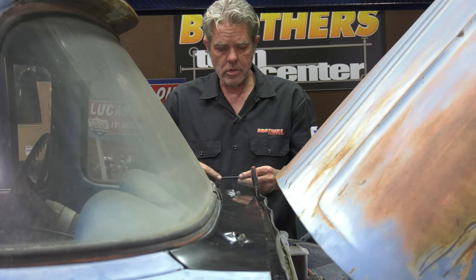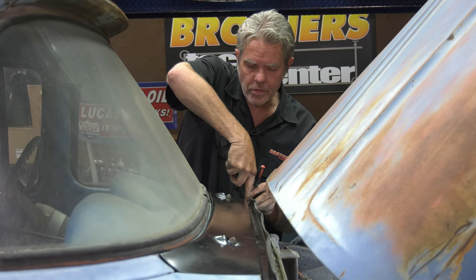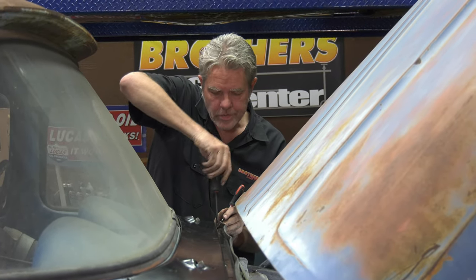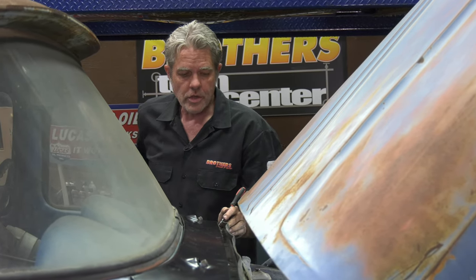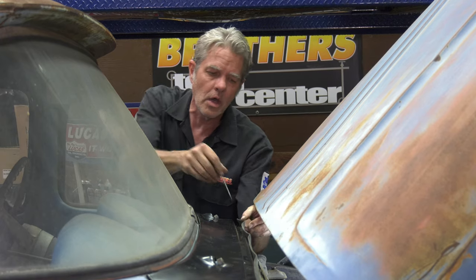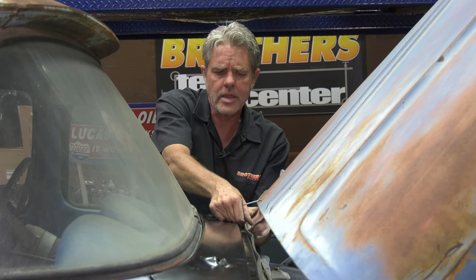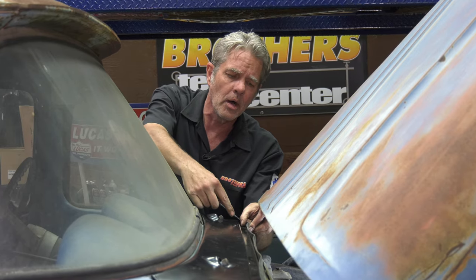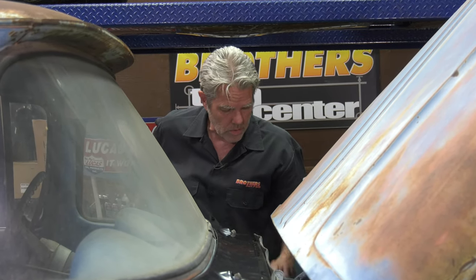I'll get my new screws — because you planned ahead and got all the peripherals, you have the screw kit too. Yes, you can use your old ones, but they are old and tired and ugly. You could go find them, but you can just order them and be done with it. So you get one started — I'm not screwing it all the way down tight. I'm going to pull the rubber just a little snug and then look for the next hole. We want to make sure that the rubber doesn't have any gaps or bumping out. Pull it just a little taut so that it is on correctly and make sure it's all the way back.